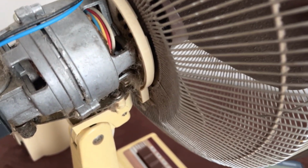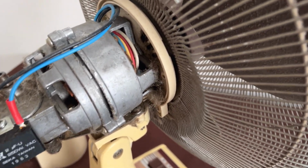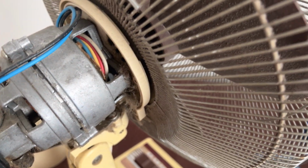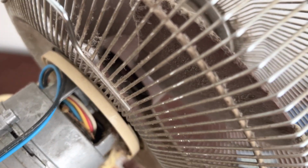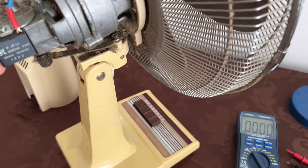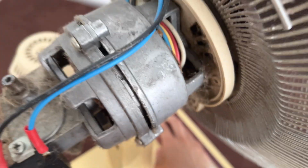to follow the wires, because if the capacitor is fine, chances are the problem is there's a disconnection somewhere in the motor, an open circuit, so it's not receiving the power or the capacitor in the circuit there. Because if I turn it on again, maybe you guys can hear it better this time. There's off again, I'll turn it back on.